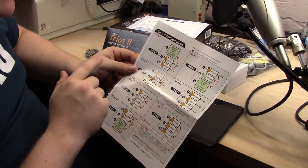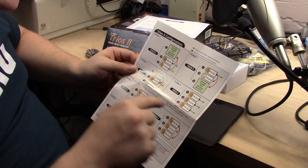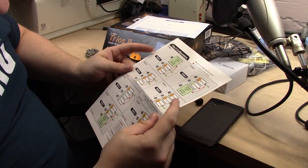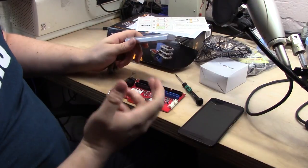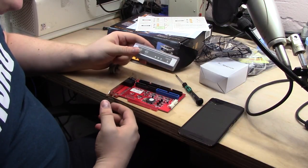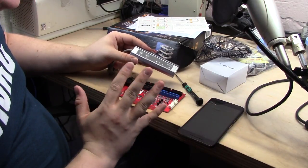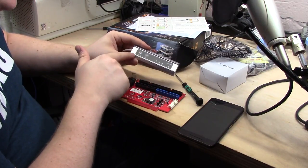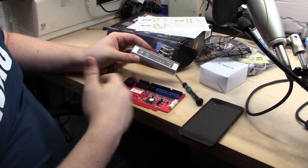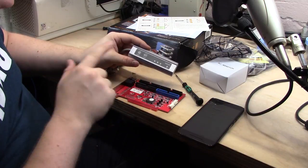I think what it's saying is that you have to set the other two drives in the machine to slave, and then you can switch between the two slaves, or you can switch between three masters. Either way, that's confusing — I'm not going to do it. I'm only going to switch between two drives. What that means, though, is this device has a lot more intelligence in it than the other one, or at least a little bit more. More importantly, they need to be able to make decisions based on push buttons, which automatically means you have to have state. You've got to have it read the value of this push button, and if it's down, it has to increment to the next value and then stay there until you press it again. So unlike the other device, which was essentially all analog logic with no digital logic at all, this one actually has to have a computer in it of some kind.